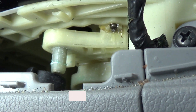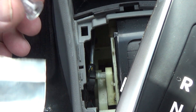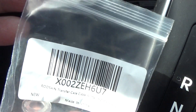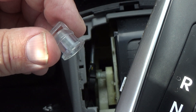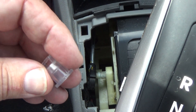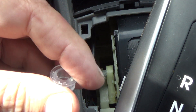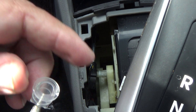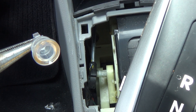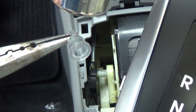I'm going to use this bushing right here — I think it's going to be the perfect fit. I ordered it off Amazon, it was a four-pack, and I've already used two of them on our Jeep. These are kind of really hard and you can't squeeze them when they're cool, but if you take the heat gun — you can also boil them in water — and heat it up just a little bit, you'd be surprised how pliable it becomes.